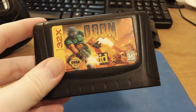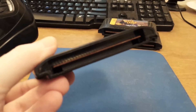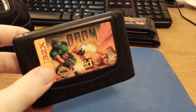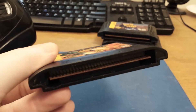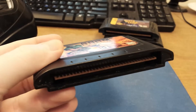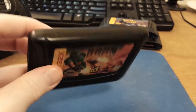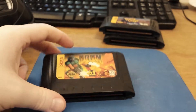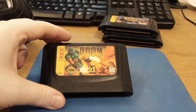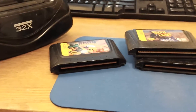You can definitely see there's some wear and tear on it — I'll probably do a little more fine scrubbing. But that's how you clean a game cartridge. You don't always have to take it apart, but with really super dirty ones like this, you definitely want to, just to make sure you can get all the connections. Sometimes with a Q-tip just inserted in the slot, you can't get all the way up in there and can still have issues. If this helped you out and you've never cleaned a game cartridge before, hopefully this helps. Feel free to leave any questions. I'm going to go through and clean the other dirty carts as well, then do some light cleaning on the 32X itself. Have a good day.